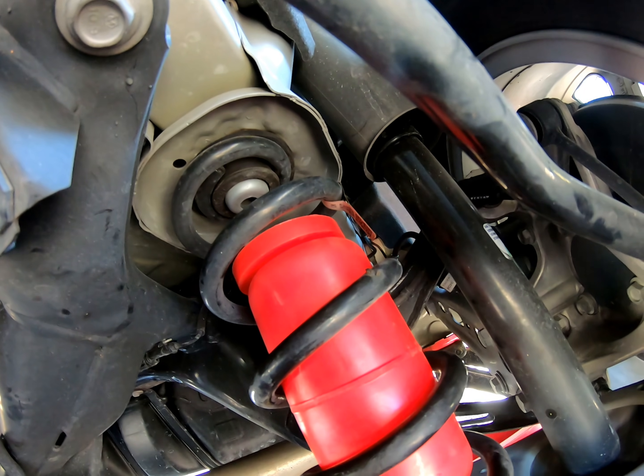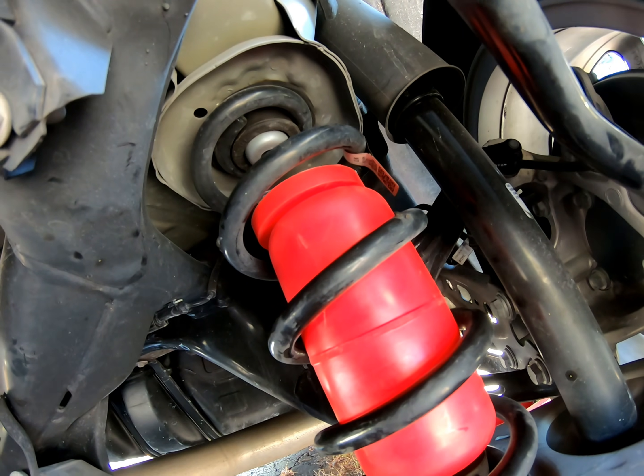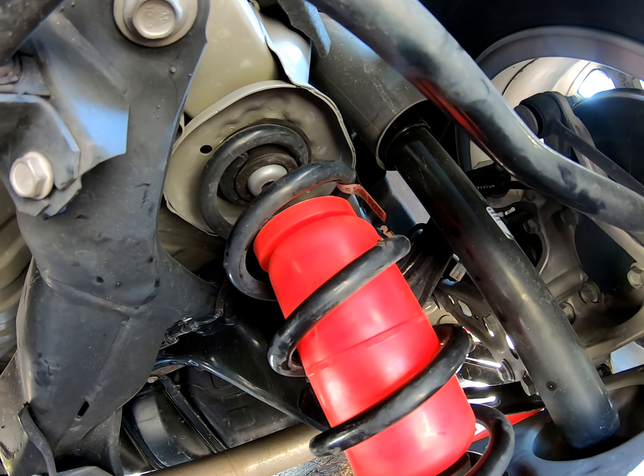Probably got it jacked up higher, got that spring expanded pretty well. I did go in from the bottom and up — went right through the middle here, got the top part in and then pushed the bottom part in. So once I cut this wire tie off it will give it a chance to expand that airbag. Put the spacer in first this time, then let it down — just trying another method.